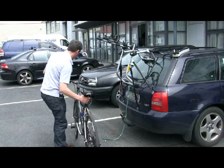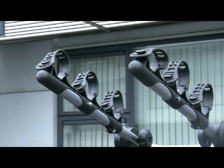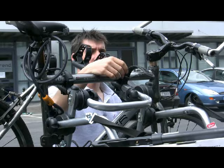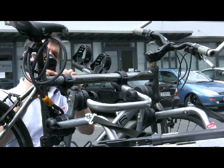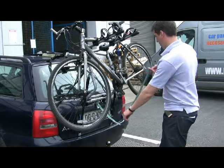This is the view from inside the car when the glass adapters are fitted correctly. Now on to carrying the bikes. The first thing to check is that the angle of the arms needs to be at least 10 degrees from horizontal. The arms on the Venezia are 31 centimeters apart, so you need to check that the crossbar length on your bikes is at least 31 centimeters so that they'll fit over the arms. The bikes mount onto the rubber holders which protect the bike's paintwork and are secured with strong rubber straps. You mount the bikes in alternating directions — if the first bike is facing left, the second should be facing right and then the third left again.